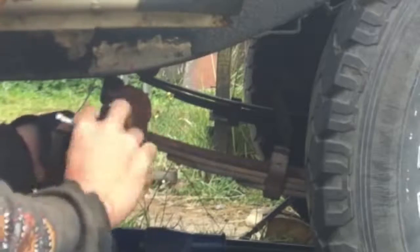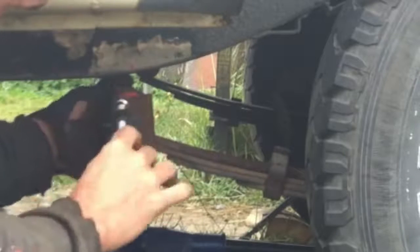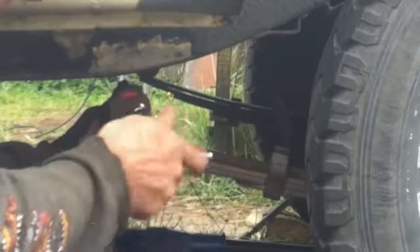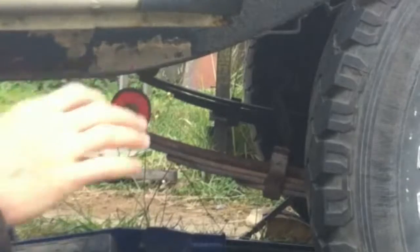Sometimes you have to stop, readjust, and slide it over, because as it's a polyurethane bushing it does flex. It's not always the easiest thing to do, but it will work out — just be patient. And voila, it's done. Now I have my sleeve in there, I have the bushings inserted, and I can put my bolt in. Works perfectly and I don't have any play. It's tight.